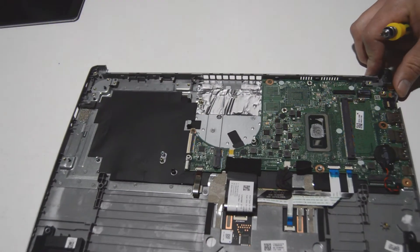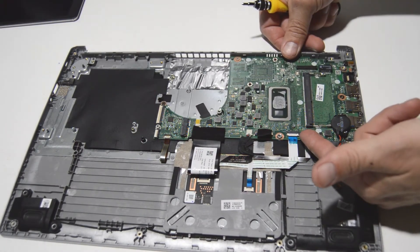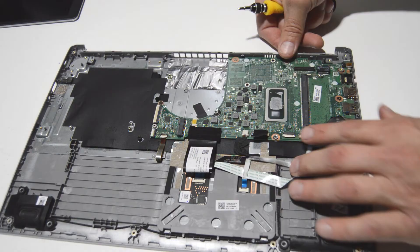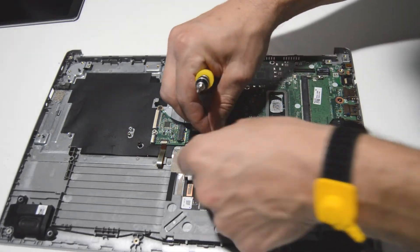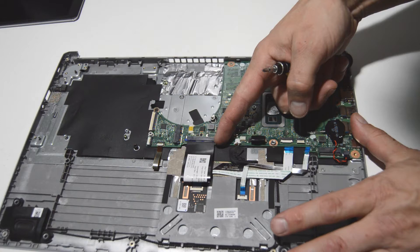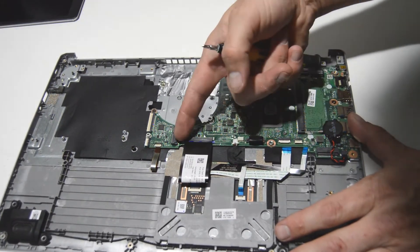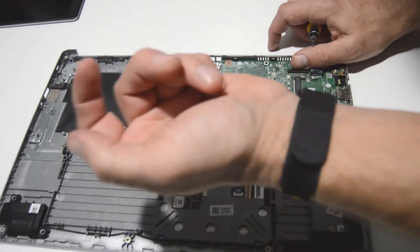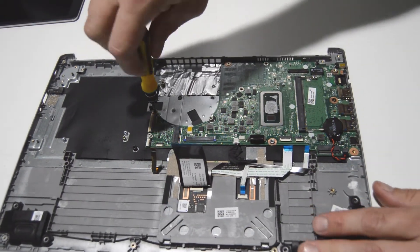The only other thing left is the motherboard. We're going to go along the motherboard and disconnect any ribbons that are connected. Same type of connector — flip up on that little retainer and then flip it back down so it doesn't get damaged. That small one there, just pull it straight out. Looks like we have some tape for the keyboard. With this type of retainer the plastic bit has to slide downwards or laterally — once you have those little tabs pushed all the way out it will release that ribbon, then push those back into place. The last one is a flip-up type. Looks like we are good to remove those motherboard screws.